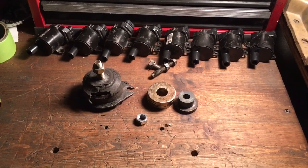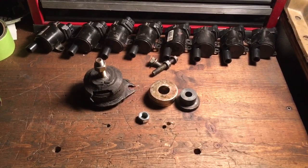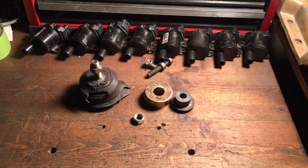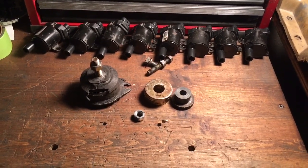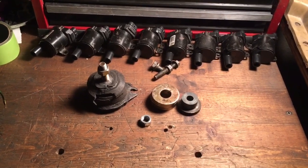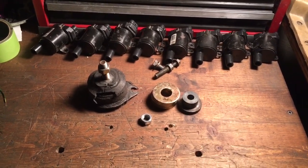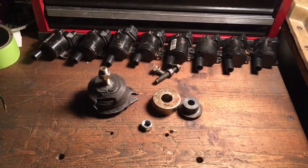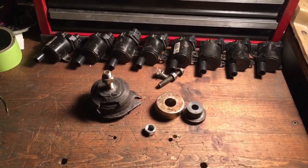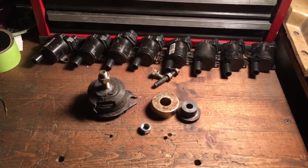I don't know what I'm going to do — the only way to properly fix this situation is to lower the engine in the engine compartment. That's going to require some cutting and welding and cussing and praying. We will have to make a video on that when it comes. Anyway, it is back on the road. We had to push the transmission toward the passenger side to regain our clearance. I'm going to go test drive it here in a minute — fingers crossed everything is going to be fixed. Appreciate you guys watching. Just made a little impromptu video — hopefully it's not too annoying and too bouncy. Thanks guys for watching.